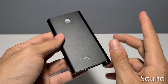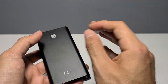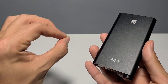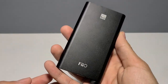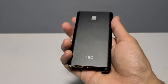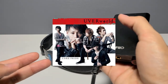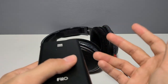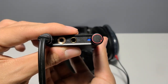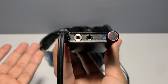Now let's talk about the sound — there is something notable here. It actually adds a little bit of warmth to the low end, particularly between the sub-bass and mid-bass. It also smooths out the highs just a teensy bit. Despite this slight coloration, the unit sounds quite clean and clear, and the portable aspect did not detract from the sound at all. Switching to high gain made the HD600 sound a bit shoutier but also increased sub-bass presence a smidge, generally hyping the sound slightly. The difference in volume is very minimal — going from low to high gain on my HD600s took me from around 4 o'clock to around 5 o'clock on the dial.